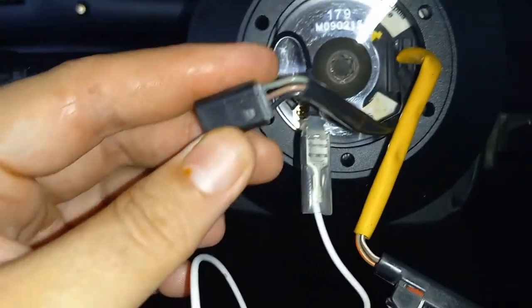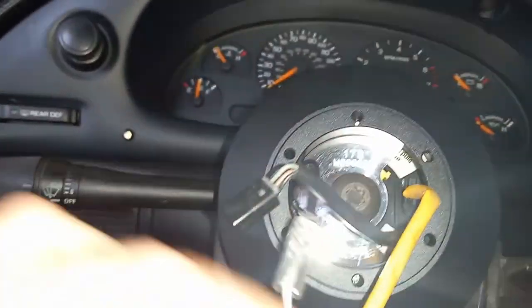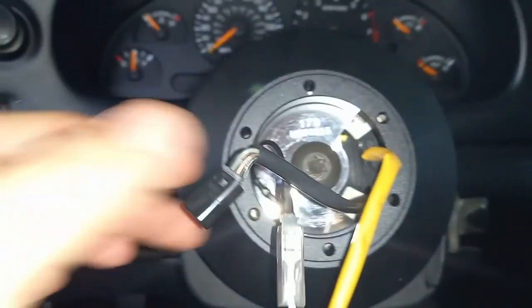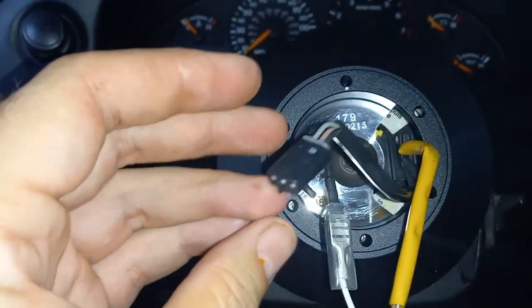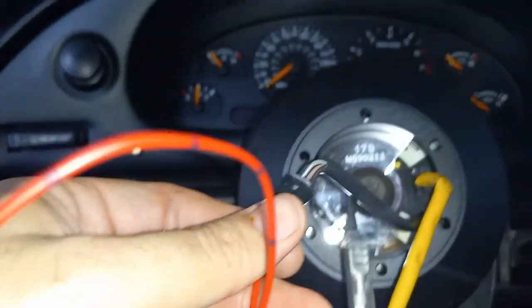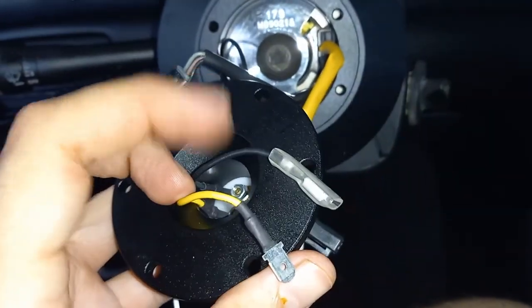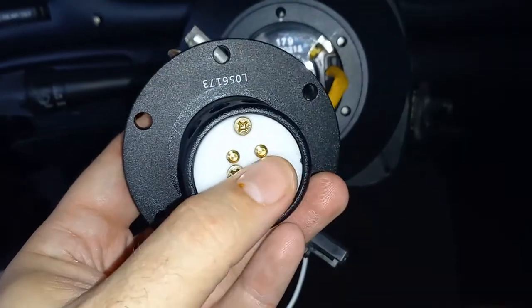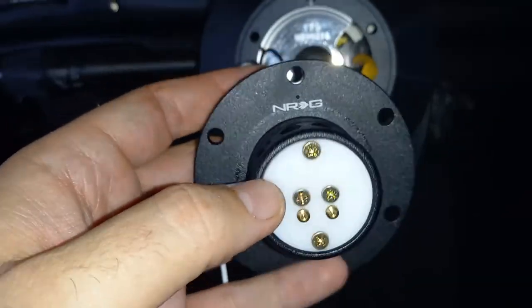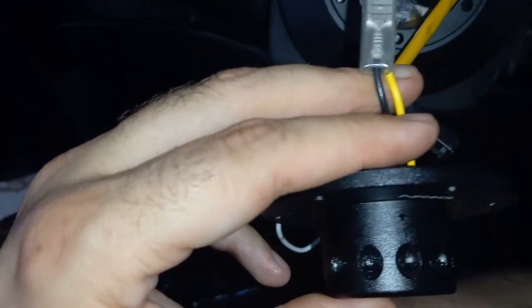I'm running this one, and as you can see in the back it is dished and has a hole to make room for all this. I'm going to feed this through and set this up. Because of the way this is shaped, it lined up perfectly with where the mark was, and if you notice there's not a huge ugly gap here. Once this is tightened down and all this is set, it'll look pretty. Now we've got to worry about this wiring. I've seen some videos that said the green wire, but mine is activated by this middle wire right here - I'll show you. If I go to the middle port the horn beeps; if I go to the outside it doesn't; if I go to the ground it doesn't. It's the middle - when the middle wire grounds out, that's what activates your horn.